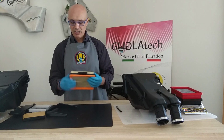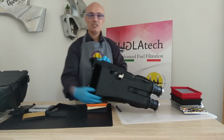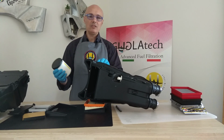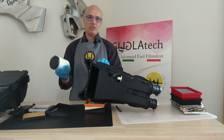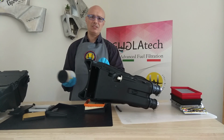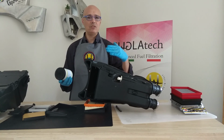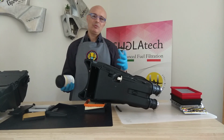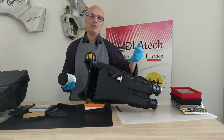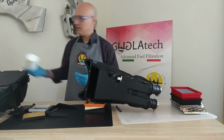Remember, whenever you're running dust, which means always, grease the lid, grease the inside of where the filter is sitting. We recommend lithium grease. We have here PTFE grease, which is Teflon. Use whatever grease. Do not use molybdenum grease. It's too black, it's too dirty, it gets everything dirty. Then you can even have sealing grease. Whatever you have at home, you can use it easily. Silicone grease, some people would say no, because in case it is ingested by the engine, then silicone might damage the catalyzer. Lithium is perfect. It's very cheap. You find it everywhere. That's it.